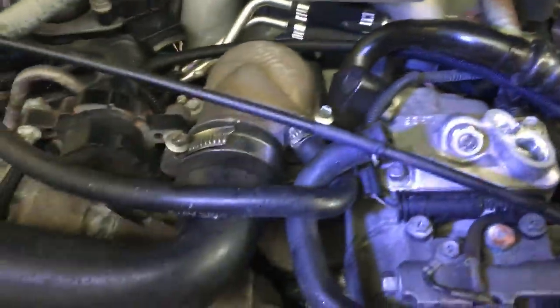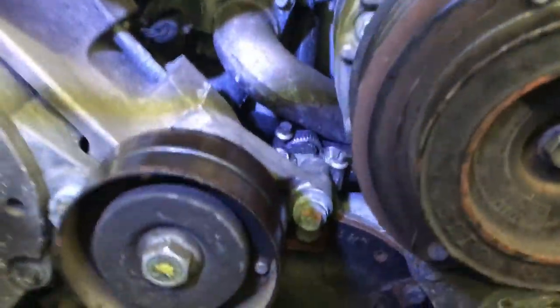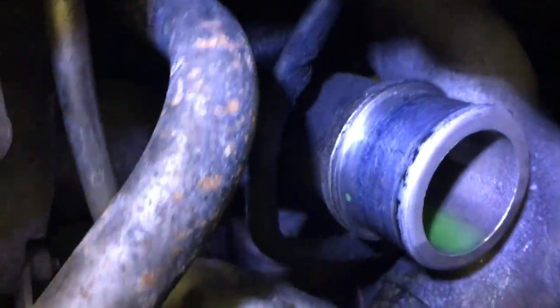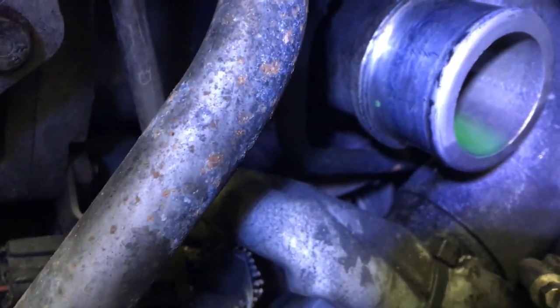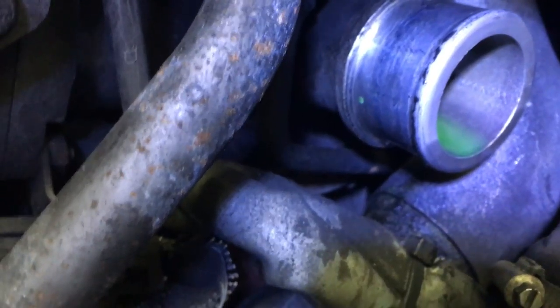We're going to drop to the front and come across this air compressor, drop right on down, and show you where a whole bunch of oil was. We have it on the other video, but it was all right here under that idler pulley — blowing oil up and down and all around in that section because it was loose. The other thing was inside the back of this area where your radiator hose goes — that was leaking where somebody left the clamp just not tight enough, and it ruined the hose between the heat and the antifreeze leaking through it and the heat off that turbo.